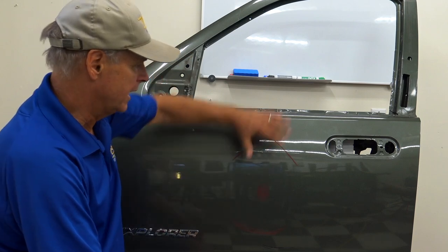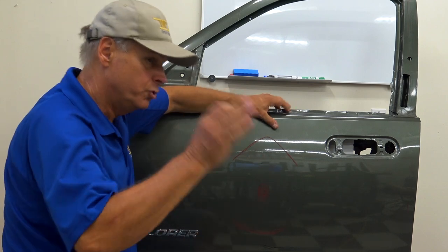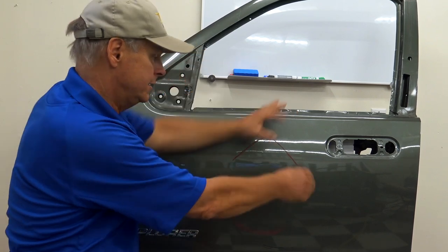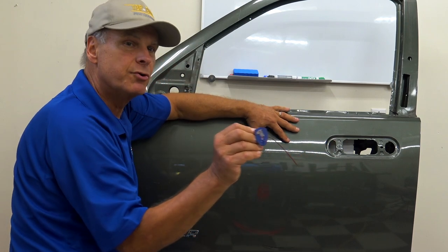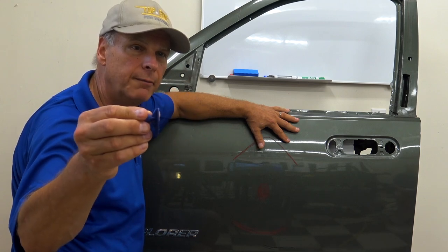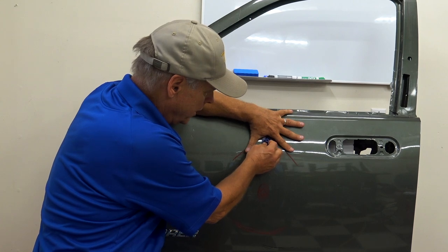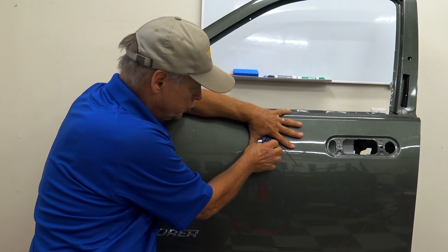So let's say that 90 degree crown angle or less, you can't use tension. What do you do? Well, what you don't do, we already talked about, is get your instant gratification. We want to take that metal and move it right back into our dent, okay? Tension would do it quickly. We can't use tension. So what we're going to do, remember the little crown director tab we showed you? Give the camera a closer look at that. That's an oval tab that you cut, okay? And the reason we cut it like that, we want to put that on a 90 degree crown as close as we can to the apex, the top of that crown. That's the apex. As close as we can to that.